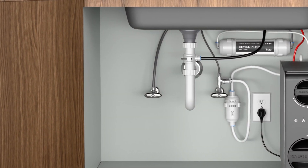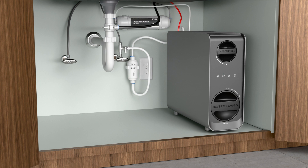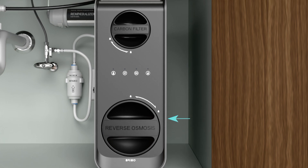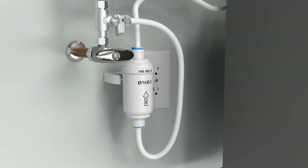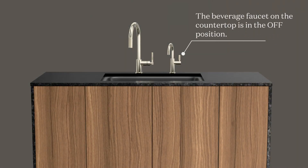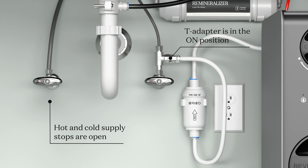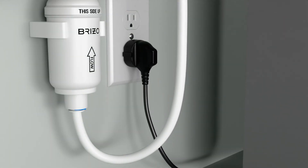Now that all connections are made, prepare the initial system startup. First, place your unit under the cabinet, being careful not to cause any undue pressure or kinks on any of the lines. Ensure the unit is on a level surface and perfectly upright, and ensure it does not touch the cabinet wall, plumbing, or other appliances to avoid vibration and increased noise levels. Clip the pre-filter into the mounted C-clip and check that the two filters in the RO unit are in the locked position. Confirm the beverage faucet on the countertop is in the off position. Once these checks are complete, supply water to the system by turning on the T-adapter at the cold water supply stop and verify that both the hot and cold supply stops are open. You can now plug in the unit to initiate the system startup, which will last approximately five minutes.